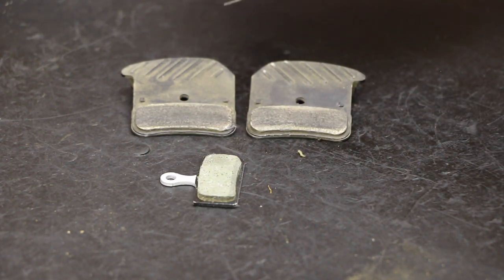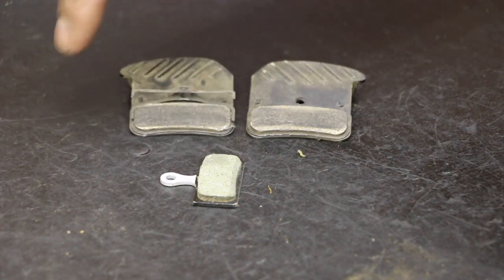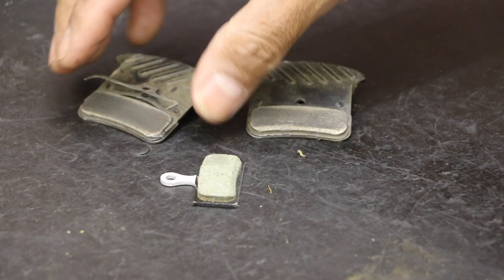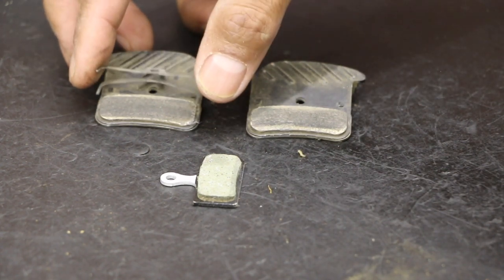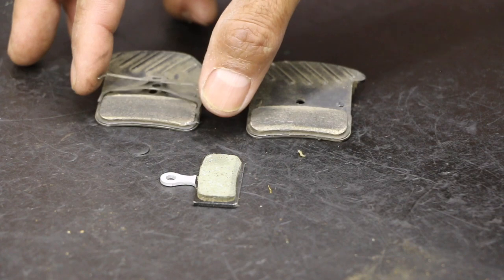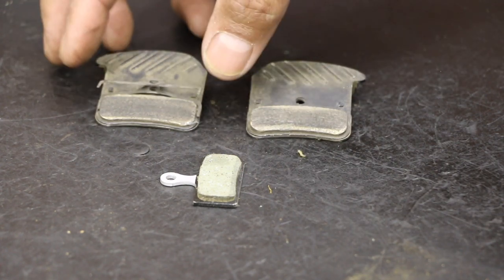The main thing with this is once these pads get worn, this spring basically outlines your brake pad. So on the edges here, if that pad gets too low, we could start hitting this metal spring here, and it may not be a really loud noise. It will be metal on metal. You might notice it, you might not. If this starts making contact with our rotor, too much of that could actually start to melt onto your rotor, and then we're going to ruin our rotor. So not only do we have to replace your pads, now you have to replace your rotor. So always good to get eyeballs in there.